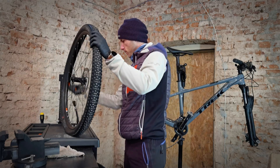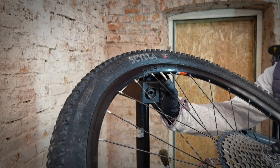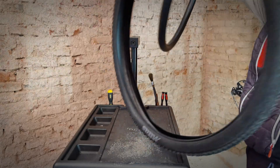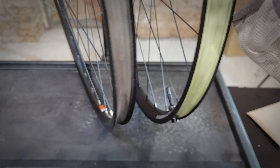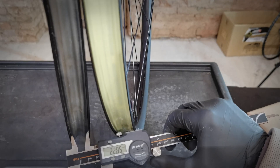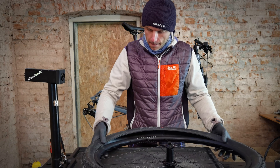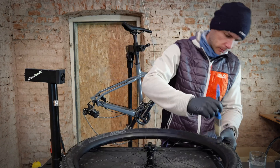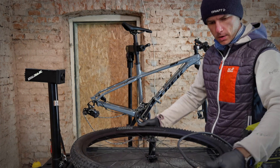Now mountain bike — an inexpensive upgrade which really makes sense. When you hear such a sound it means the tire was already sealed on the rim. We are replacing the old alloy wheelset with a new one — also aluminum but with much wider rims and 600 grams lighter. The wheelset will be the first thing you might want to upgrade on a budget bike because the wheels will be the weakest point. You can see the difference in rim width: Dandy Horse 27.3 versus 22.8 — a huge difference. My customer will have lower tire pressure, better puncture protection, and much better traction.